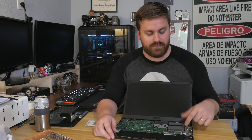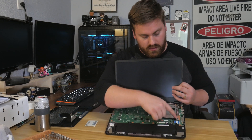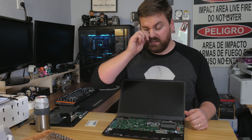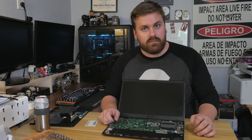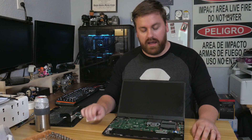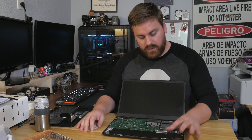If all that you're doing is installing a two-and-a-half-inch drive, you can do that right here. You've got one screw here, here, and here — three screws. You can slide back the drive cage and slot in your two-and-a-half-inch drive. I think it has to be exactly seven millimeters, so you can't have a nine-and-a-half-millimeter hard drive. But if that's all that you're doing, you can do it right here. If you want to install another DIMM though, you've got to remove the whole mainboard. So that's kind of stupid.